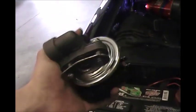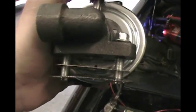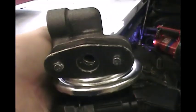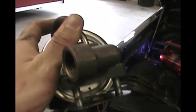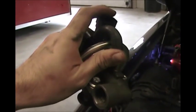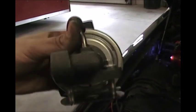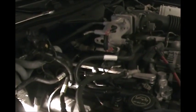We'll go ahead and get our new one ready. Here's our new EGR valve — I've got it prepped with the gasket. We've got that thin middle gasket that I showed you on the old one, and we've also got a little rubber gasket that also came with it. I bought this one from AutoZone, from their website. So let's go ahead and put it in — first thing we're going to do is those two ten millimeter bolts again.